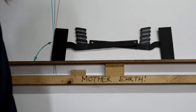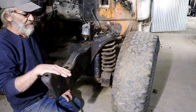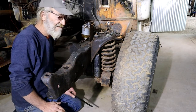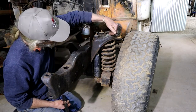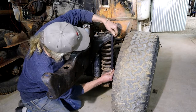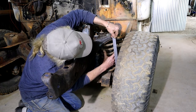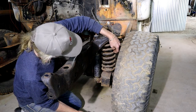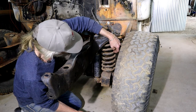I understand it much better now. I have measured in the back that if I put the differential on top of the leaf springs, I'm going to get a change in ride height of 145mm — about six inches. So at least in theory, I should cut the spring down by the same amount, which would mean roughly cutting the spring around here somewhere. But that means I'm reducing the spring length radically, which is going to make the suspension a whole lot tougher.